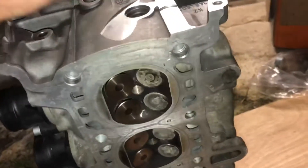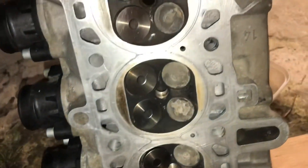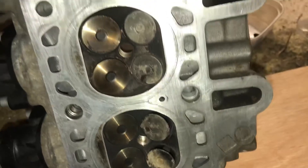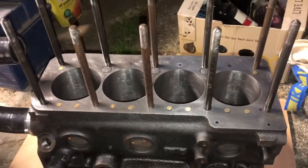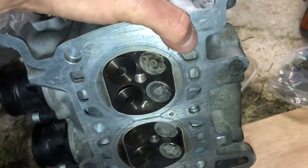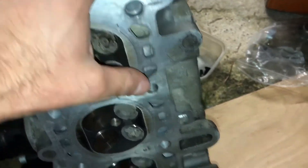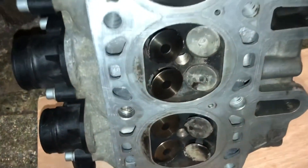I have one of these heads at the machine shop, and when drilling the holes accurately the guy plotted the cylinder head to find where the stud holes and waterways should go. He started transferring over to the block and said the block was horrendously inaccurate — Mini blocks aren't known for being great. But then he said all the studs across this gap were 86mm and across here were 76mm — exactly on all of them, the tolerance was shockingly good. So it's a nicely engineered bit of kit.